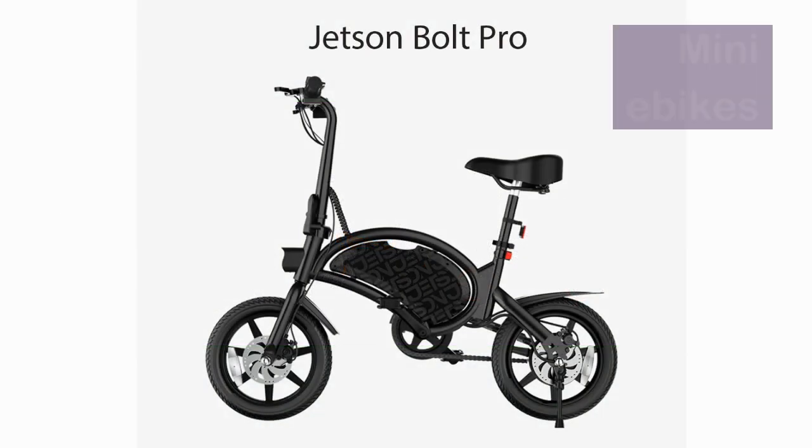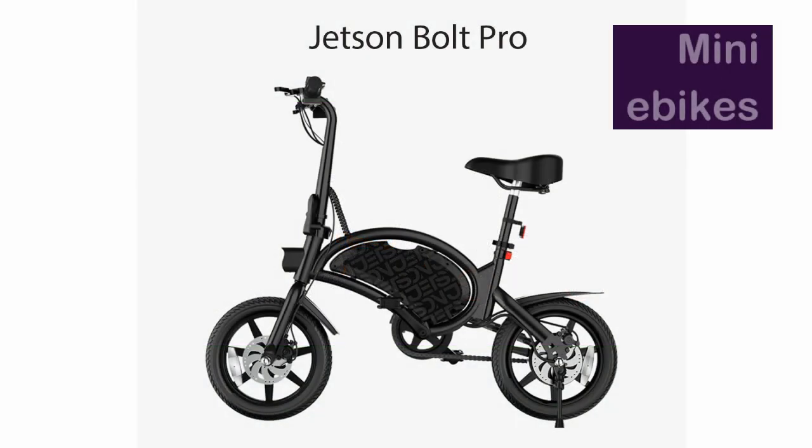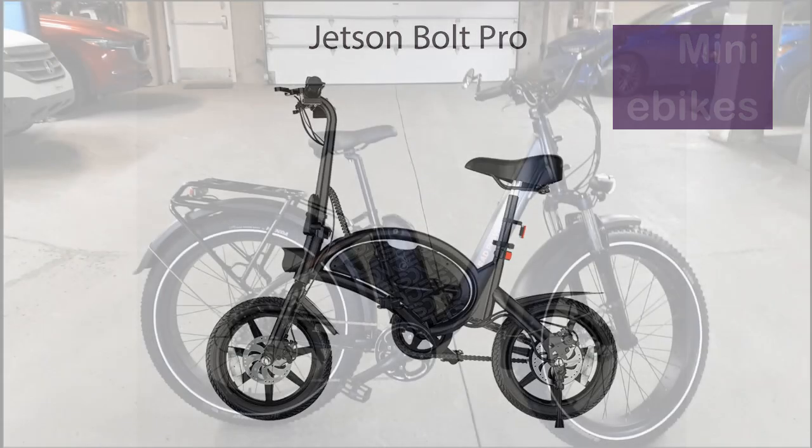A case in point is this cute little Jetson Bolt Pro, which sells for about $400 in Canadian currency. It has a 350-watt motor, which is pretty adequate for a machine of its size, and its battery has a capacity of 216 watt-hours, which would be good for about 20 kilometers with moderate pedaling.